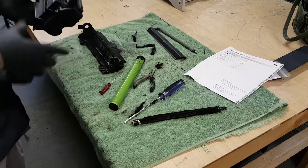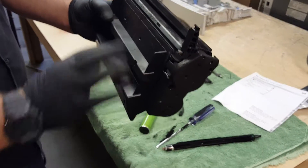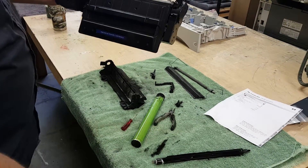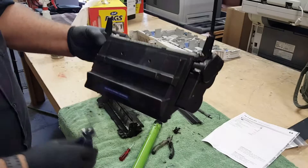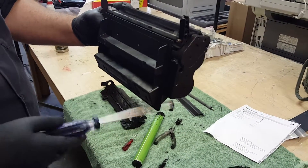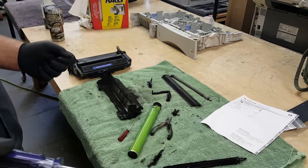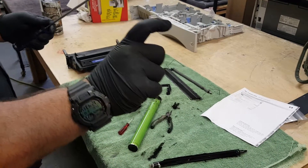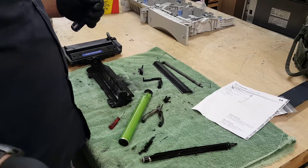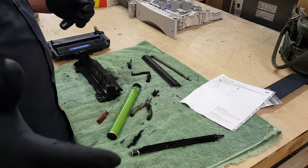This is the toner hopper side where all the new toner goes in. It's hard to get the feel for this through a video, but you can tell that thing is just hollow. There is some toner in there and it was still printing. However, when I looked at the initial prints for this call — there was a stack of paper about that thick — you could tell they were printing way outside the 5% coverage range, which is what HP recommends.